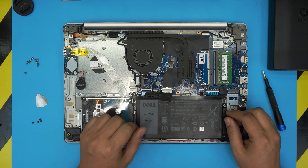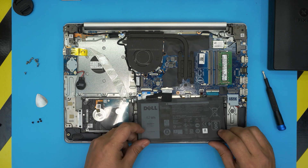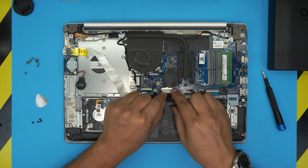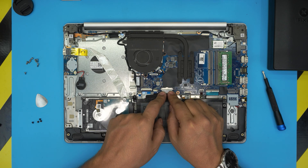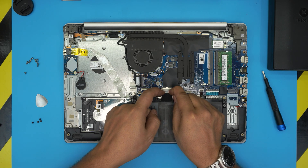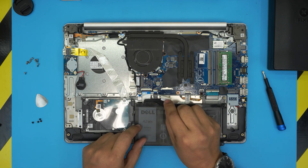Back to the main internal battery — pick up the battery and bring it back a little. From here you can pull the jack by putting your fingers right on the hooks on the side of the connector. Wiggle it around and it will come out eventually.